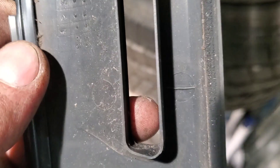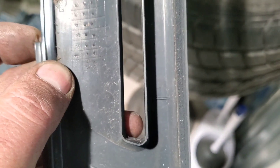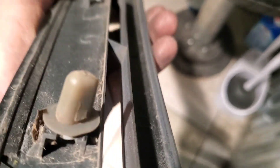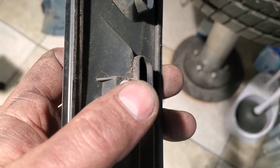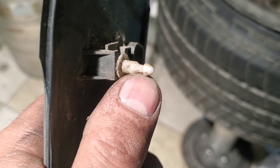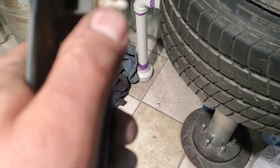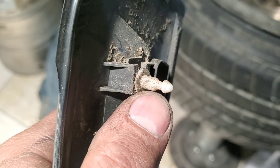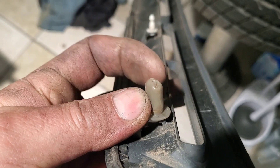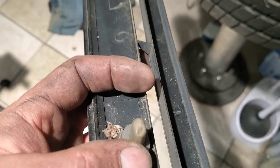I've got another Pathfinder so maybe I'll steal that piece out of that one. These clips — you just put a puller and pull them off. I was able to get one out of the body but couldn't even get to the middle one; on this one instead of it pulling out of the body I pulled the clip out the other way. I was concerned these might be brittle and break off. I'm not going to remove this one — I'm just going to stick it back in the body as I put the panel back on.